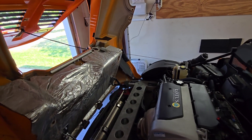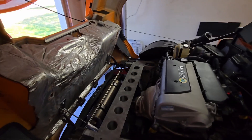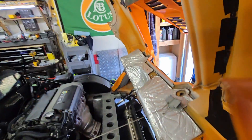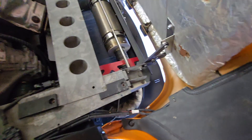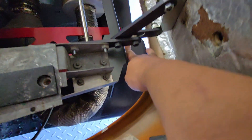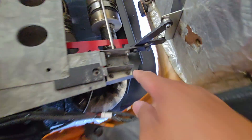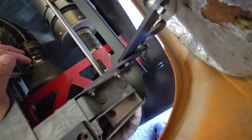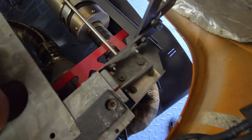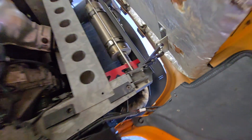The clam is now being held up by a cable. One thing to be mindful of: if you have a rear tow hook that attaches to the frame, I have an Inokinetic one and it did not fit because the clam kept hitting it. I tried bending it down but that didn't work well. Right now I just have it cut where it's sticking out with a loop I can throw on there. I believe the BOE tow hook, which sits vertical instead of horizontal, does fit.